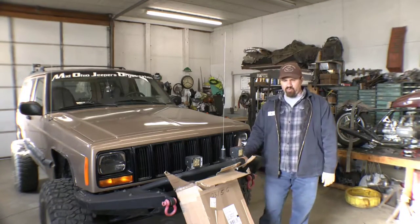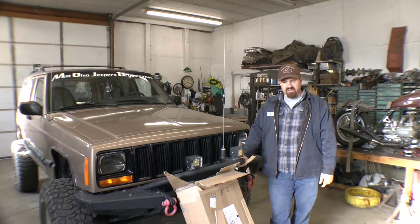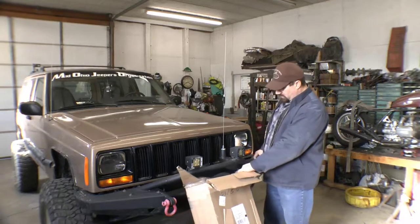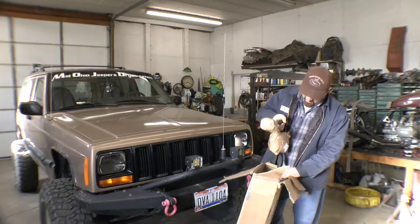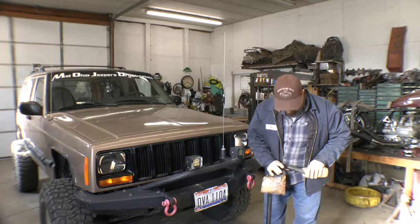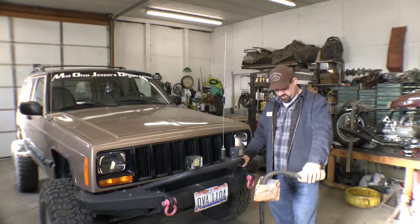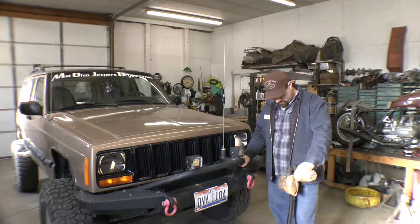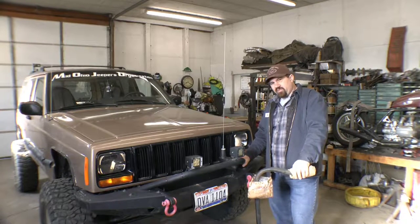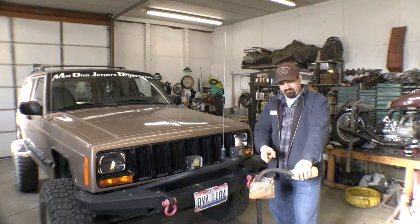Hey guys, so it's Saturday morning and Kagan's on a side job and Adam's golfing because it's nice outside. So first thing I want to do is go to the garage and find something to work on. The project today is I got this delivered to the house the other day. This is a Grand Cherokee anti-sway bar. It's about 10 millimeters thicker diameter than the XJ anti-sway bar, and we're going to try and swap this out today and see if we can't improve the handling on the road.